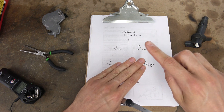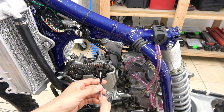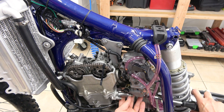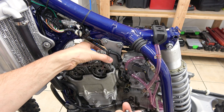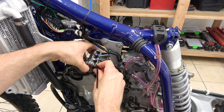So what we need to do now is remove the camshafts from the head. My goal during this entire procedure is to not have to redo my chain timing at the end — I know the chain timing is good, so I want to keep it this way. That's the reason why you see me putting a zip tie right now between the chain and the camshaft, just to make sure the chain stays where it is. I'm loosening up the chain tensioner right now because we need that chain loose when we move the camshaft. So right now I'm taking the chain tensioner off — don't forget to do that. Then I'll take care of all the bolts on the camshaft cap and remove them. Then it will be time to remove the camshaft cap. I'll make sure I have that half-circle clip you see inside — don't lose it, don't misplace it. It keeps the bearing on the camshaft in place. Super important. I'm putting the camshaft out of the way.